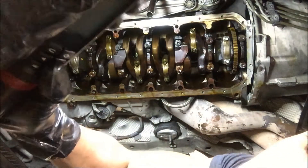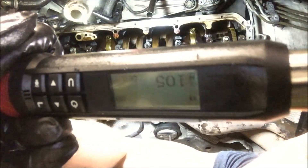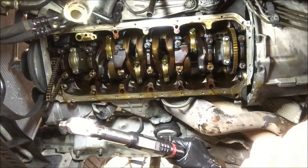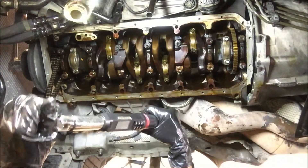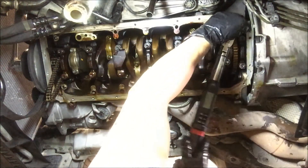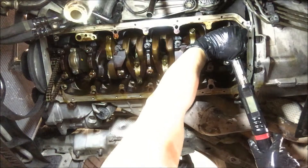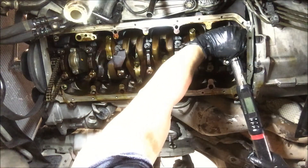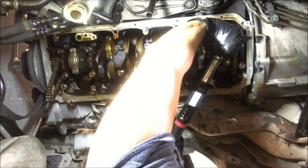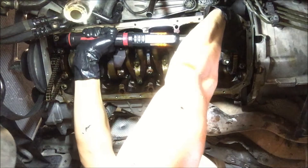Alright, you can see I just set my torque wrench to 105 degrees now. If you have a dolly, get off of it because the dolly makes you roll around when you try to do this torque. The 3/8-inch drive makes it a little bit harder but it's still doable. Start with the top bolt, get it on there real good, make sure it doesn't flip or you'll strip the bolt. Once it's on there, use your left hand to hold it up there, get your feet for leverage, and let's go — 25, 50...